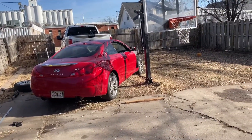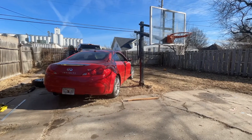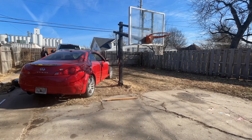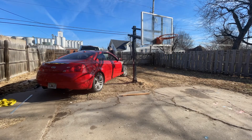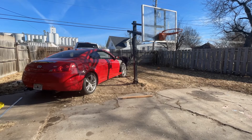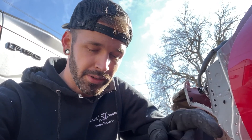I'll put the camera back here so you can see how much the basketball goal moves. After a few more pulls, I'm about at 546 on my tram gauge, so it's only off by four to five millimeters. I don't think that's going to have a whole lot of effect on putting the fenders back on and lining everything back up, so I think we're just going to run with that. I don't think it'll cause an issue with alignment. I'm going to go ahead and put the strut back in, put this control arm back up, put the tire back on, and put it back in the garage. Then we can start welding stuff back together.